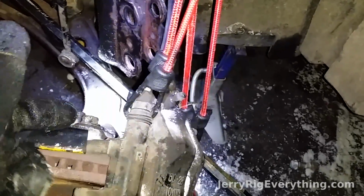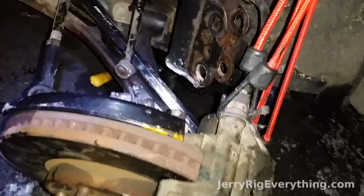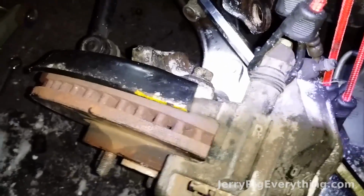And so when I try to twist any nut, like let's say this nut back here on the caliper, the whole thing kind of shifts. The whole thing rotates so that I can't get any traction anywhere with it. Now, what I've done to fix this problem is taken a huge crowbar, put it right back in there. The crowbar is this one that says Pittsburgh on it, and I have propped it up with my leg here. Then when I try to rotate this, instead of going forward, it just rests itself on the crowbar, which allows me to take off these nuts.